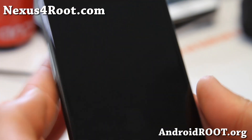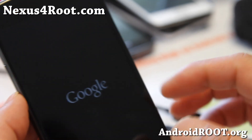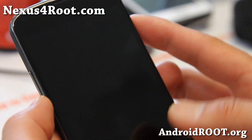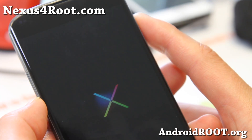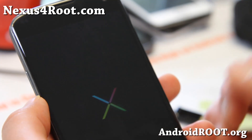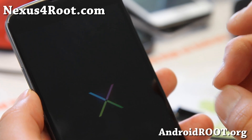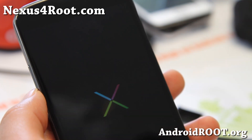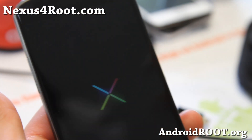And that's how you install a new ROM. Now if you mess up and end up in a boot loop, you can hold down volume down and the power button, which will reset your phone, and then you'll be able to enter ClockworkMod Recovery. From there you can try reinstalling a ROM, or you can restore your backed up ROM and get your phone working. We should be booting here shortly.